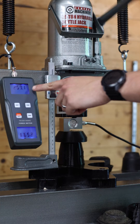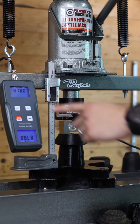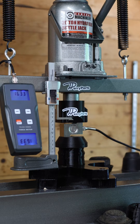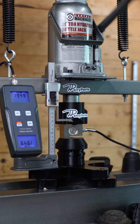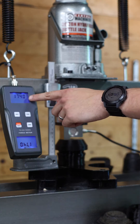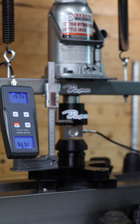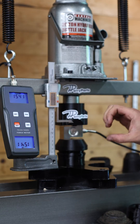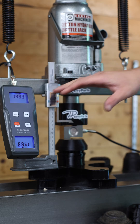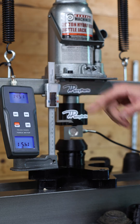Keep an eye on the force feedback here. You'll see that as we come up to the limit of the tester at 2200 pounds, the PeriParts Aero Bump will actually leak down pressure. We came from 2,190 and we're bleeding out air. What this shows is that during those hard impact hits, the bump stop will actually be stiffer, and then as you compress it more slowly, the bump stop will build less pressure.